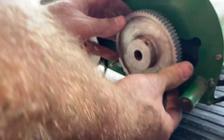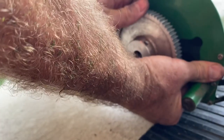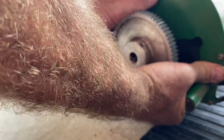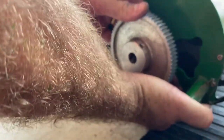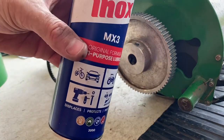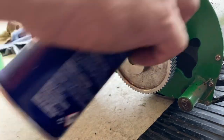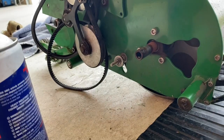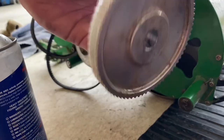The challenge is to get that pulley off. Oh, it's actually moving — I don't know if you can see that. That's actually moving by itself. There we go, it's fantastic, this pulley's moving by itself. As a tip: just put a bit of grease on the shaft to make sure it doesn't lock up next time so you can pull it off easily. I was going to give it a hit with Inox but it started moving by itself. Happy days — that was all too easy.